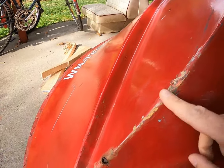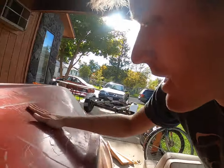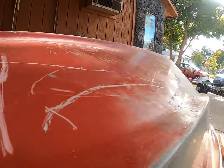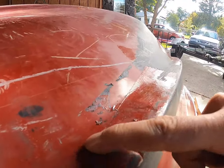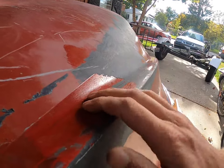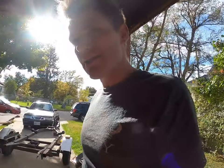We got some chunks out here. And then this is where the eye bolt was, where you can hook the trailer on. So yeah, that's the hole. The more I look at this, you can see it's pushing out a little bit here. It does look like someone painted the top section of this boat. I think this bottom part is the original gel coat, and then you can see the line here where somebody taped it up and brushed this section on. This part looks spray painted, and the whole side of the boat was probably also spray painted. So I might just use spray paint to redo the whole boat, because it's a little bit easier to work with than gel coat. I've got to decide what kind of paint I'm going to go with though.